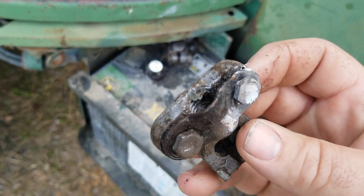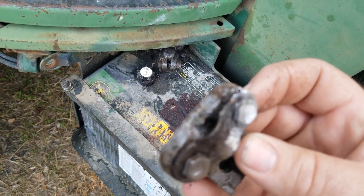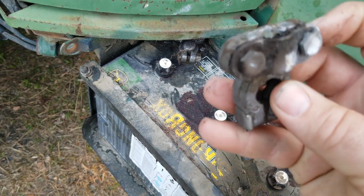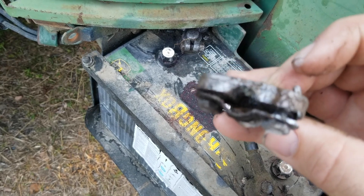Like, no power at all. So there was enough juice clearly in the batteries to engage the solenoid and make the starter bump just a little bit. But then whatever little bit of contact was being made melted, and then there was nothing.